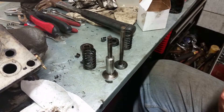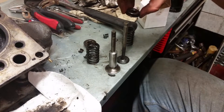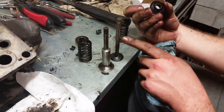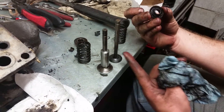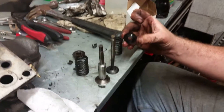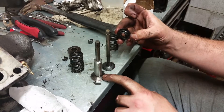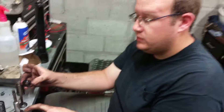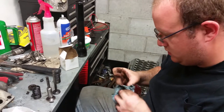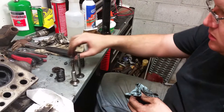So that gasket must be to keep oil from running down from the intake. But what I don't understand is the exhaust doesn't have that seal — the exhaust is the only one with this spinner on it. I don't know if this is meant to help pump oil along the valve stems and keep it out of the exhaust. I mean, you're going to have positive pressure here pushing your oil back up a little bit, but that wouldn't exactly answer all of our oil burning issues. Unless maybe there's something goofed with these seals. I didn't really see any signs of oil being sucked in on the intakes, so I'm thinking it's a bottom end issue or maybe something dealing with these little seals.